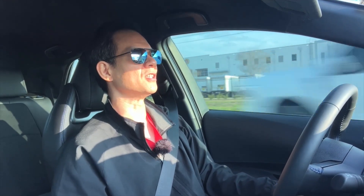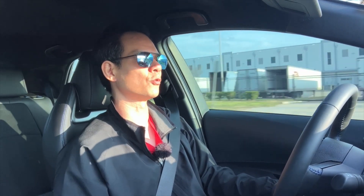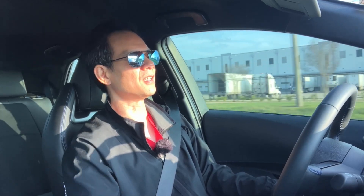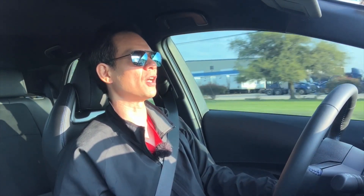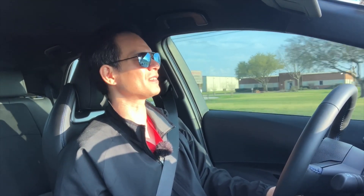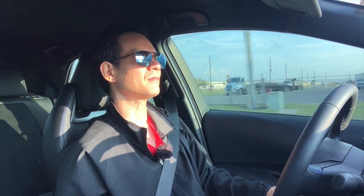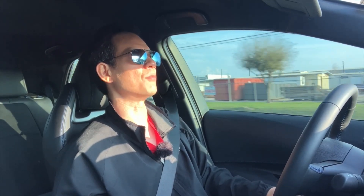It's a pretty nice car for what you get. These Alcantara seats are real nice — I really like them. Would I rather have the faux leather like in my GS350? Yeah, it's definitely nice to have — I feel like it's a little bit more luxurious than the Alcantara. Plus Alcantara I feel is a little hard to take care of. But it is kind of a luxury race car designation thing, so I can appreciate that. I'm still bedding in the pads for this car — I really want to get that pad imprint worn off before it turns into what's called cross-contamination on the rotor, because once it turns into that, it's not going to go away and that'll be a major problem.